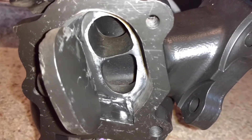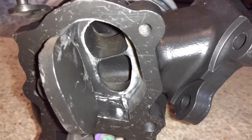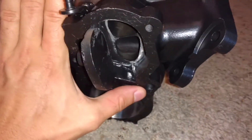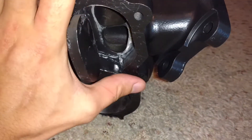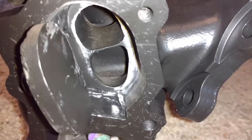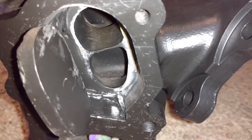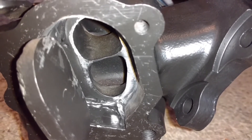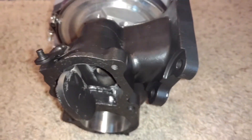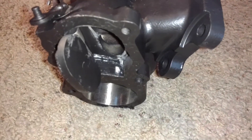There is, I believe, a 42 millimeter single flapper design on the stock unit, and this is obviously a lot larger than that. I'm not sure if you can judge by my hands — not very small — but that's a very large port opening. So the idea is I want to be able to control the turbo from anywhere from like 8 psi for wet weather, upwards of 25-26 psi on E85. And doing this design this way is why it will work. So we'll see.